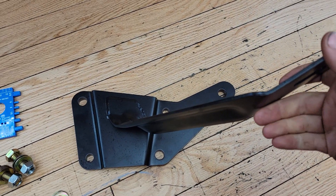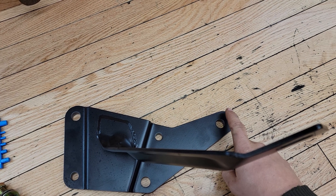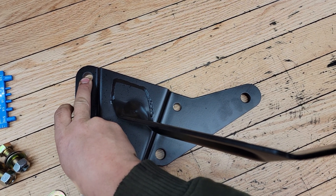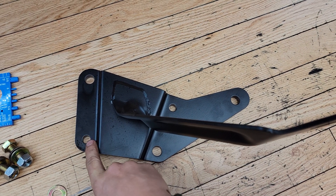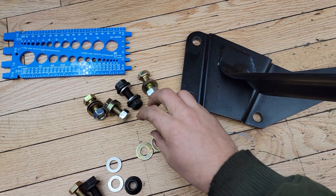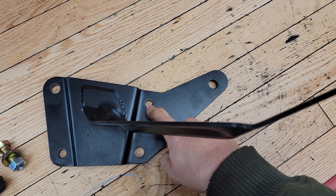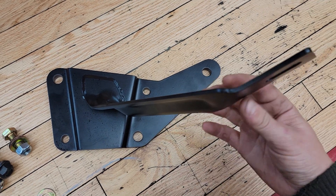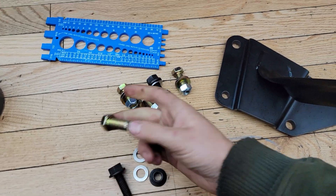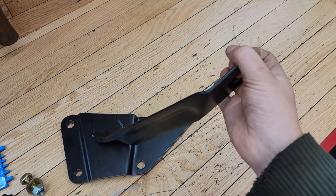Because the W250 has an additional mounting plate on the steering box to mount to the frame, the bolts attaching it are three bolts — this one, this one, and this one. We're going to use the factory bolts from the plate to the frame, and this brace will sandwich between the brace and the frame. You'll need one bolt for that — probably this half-inch bolt — and you won't be able to put a bolt in one spot because the plate between the frame and the steering box blocks it. You'll also need a bolt for down here between the steering brace and the cross member. Fine thread would be nice for more clamping force to make sure this brace doesn't move.